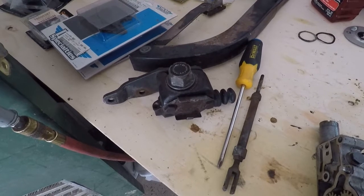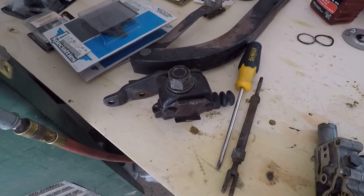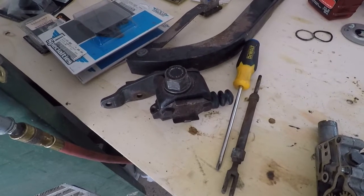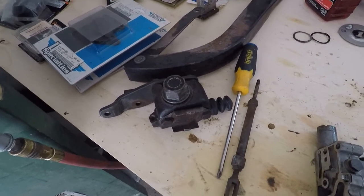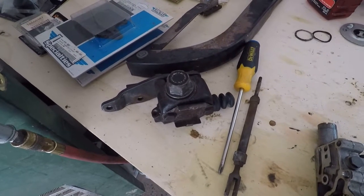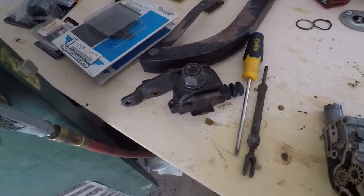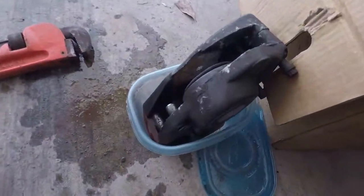Alright, so the rear master cylinder is rebuilt. It actually had fluid in it, but it was full of rust. Just gunk. Got new lines on order for the front and the rear, although the lines in the rear weren't as bad. Got the caliper off. It's draining.